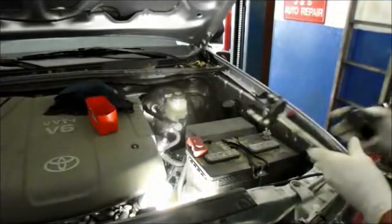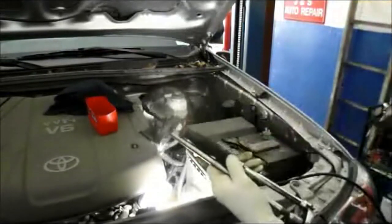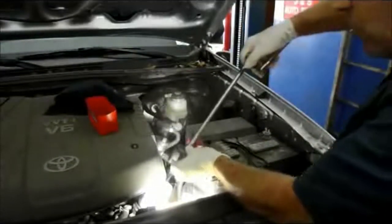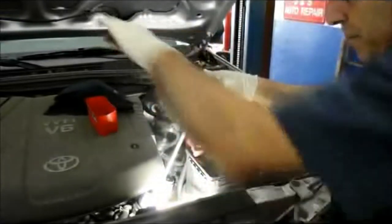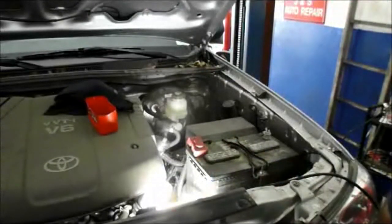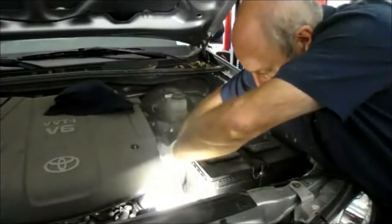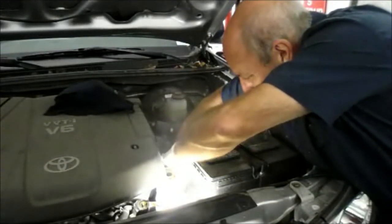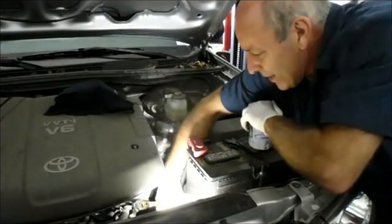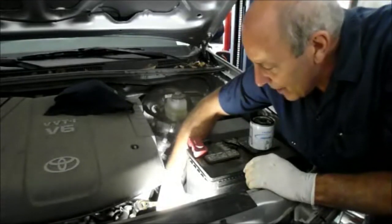There are different kinds of tools you can use to take the oil filter off. You can use a cap-style wrench which goes over the top and loosens the filter, but I kind of like this one better because it digs into the filter and pulls it off without problem. The first thing we're going to do is loosen the filter just a little bit so we can turn it off by hand, and then we'll let it go underneath there with that cut-down oil container to catch the oil. By holding the container underneath there, you can catch all the oil so it doesn't run down all over the hoses and the bottom of the vehicle and make a mess.